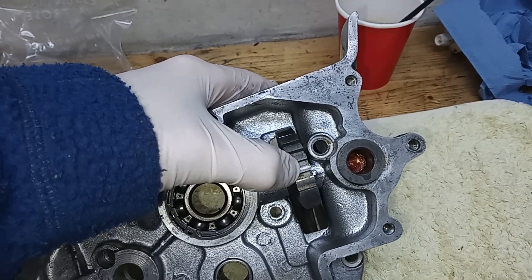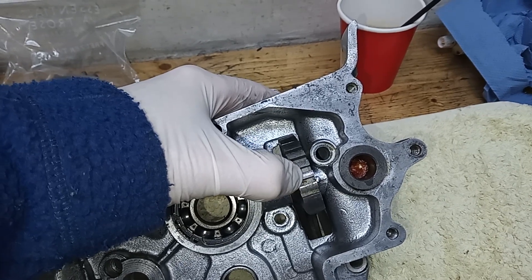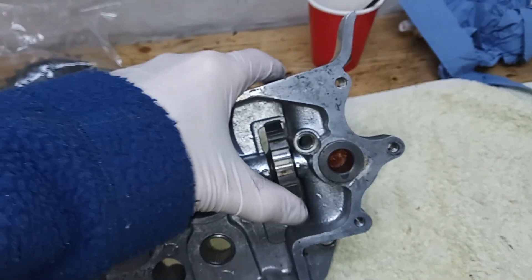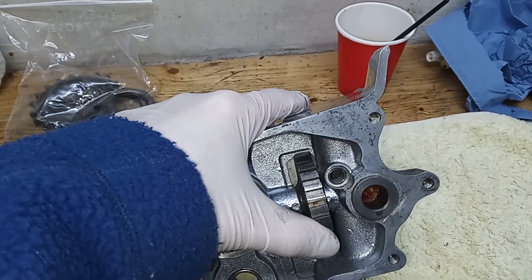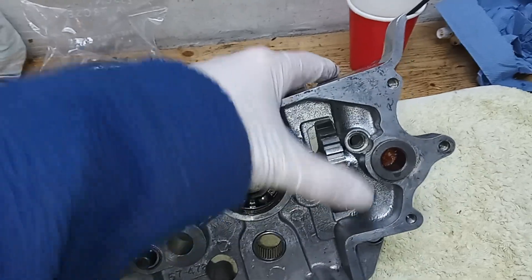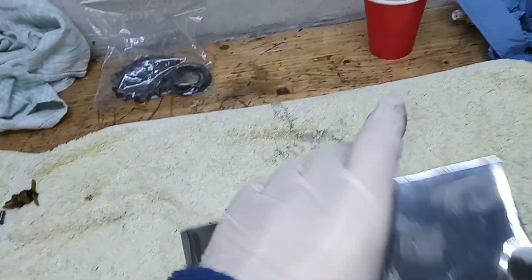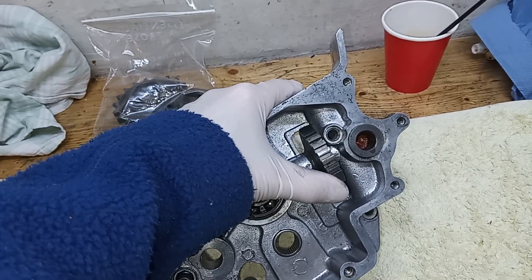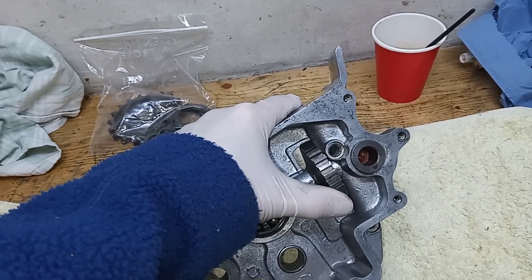This tooth here has got to be in line, just in line with the centre of that bush. Basically if we put it in at the very very top it won't work. We go down one tooth on the quadrant basically — just one — and that'll be it.